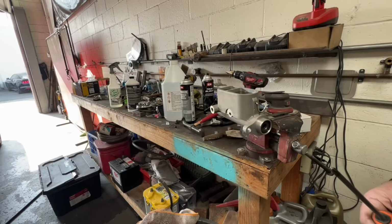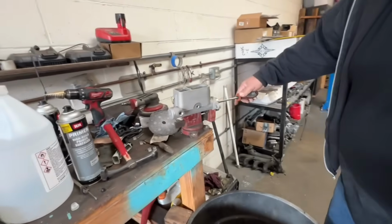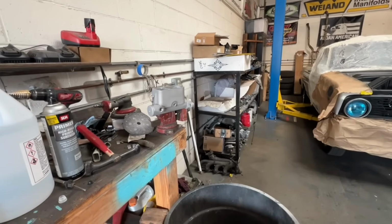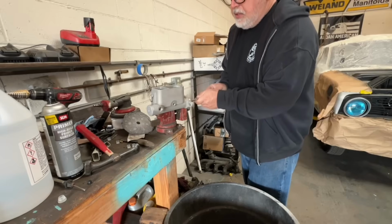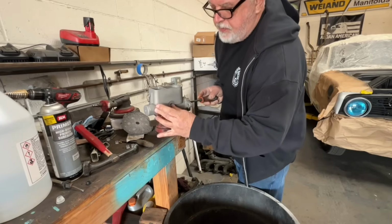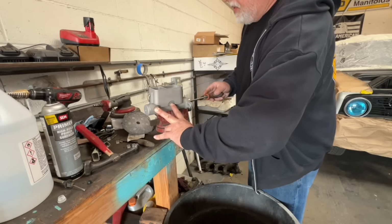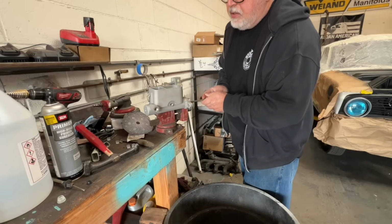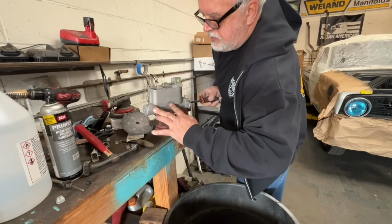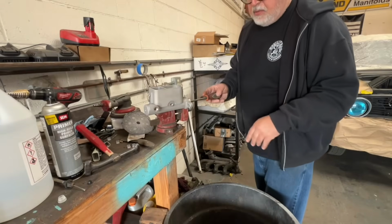Okay, the trick here is to not shoot brake fluid across the parking lot. We're just going to depress this in. Actually, I may have to move this over here. So I have to be able to block things off while I do it. So depress the master slowly. Once it's completely bottomed out, block off these two holes. You can't really see it, but it just sucked all that fluid right down. Now I can remove my fingers and slowly depress it again. Block off these two holes. When I let off, I saw it suck more brake fluid. This is probably going to put some out.